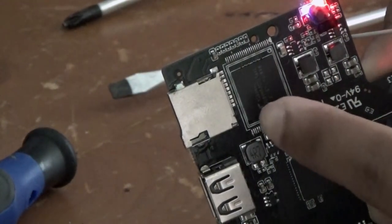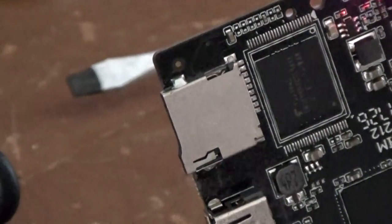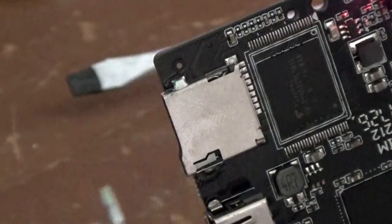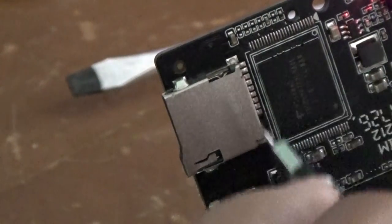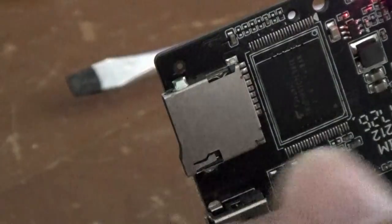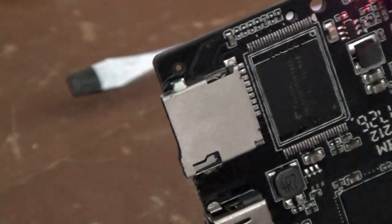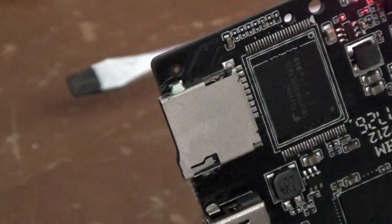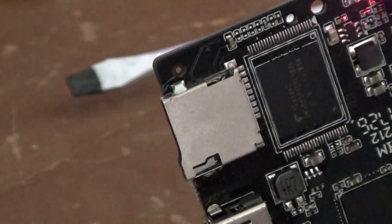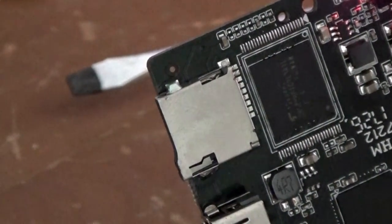What we're going to do now is short out the NAND chip — that's the big chip right here with all the little legs. All you're going to want to do is press your flathead screwdriver against two pins to short out the chip. What works for me is shorting out the first two pins next to the arrow. That'll cause it to short out and it'll become recognized by the computer. Make sure you have the drivers installed from the USB burning tool — I'll have a link to the program in the description. Let's short the chip and get it recognized by the computer.